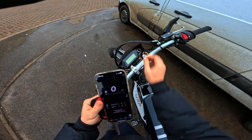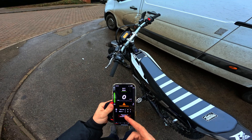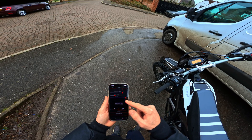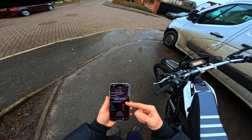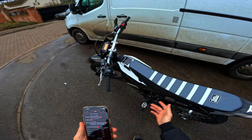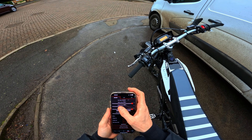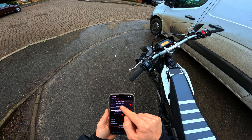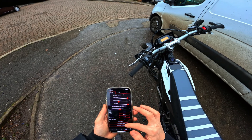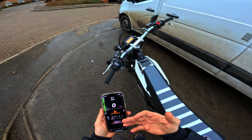We've just booted up the Torp app. I'm going to turn the bike on — it's automatically connecting. I'm not going to take you through the whole calibration step because it's very easy, it does it all for you. Here is where you select your power levels and battery. They have all the options: stock Ultra B, bypass Ultra B, 72 volt aftermarket, or 80 volt aftermarket. Today we're using the stock battery. In sport mode we've set it to 14 kilowatts but we're going to turn that up as high as it goes — 19.3 kilowatts, 800 amp phase, and unlimited RPM.